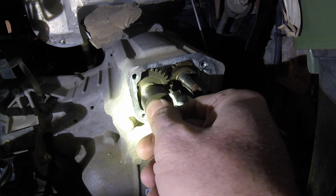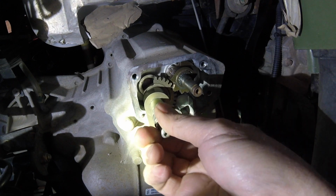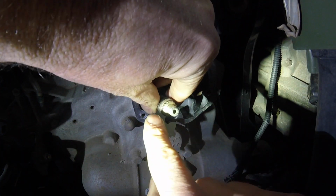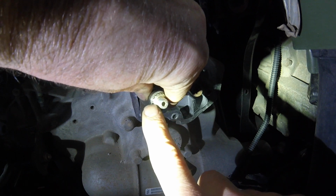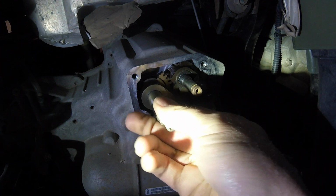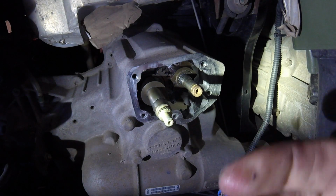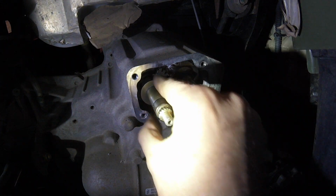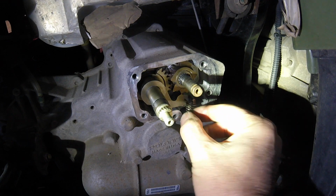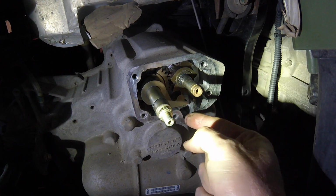Alright, this one's gonna go. Now I've got it where that key is. I know it's about the 9 o'clock position, so I'm gonna put that in there. That keyed piece is right there. I don't know if you can see that wider notch right there. Okay, that's going to go like that, and then the detent pawl is going to go right there, and then I've got a spring that's going to go down in this slot right here, and pushes up on that detent pawl into those notches. I've got to adjust that a little bit so that detent pawl will go up there.